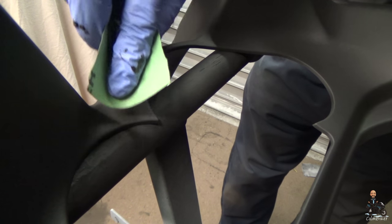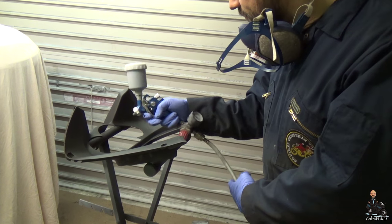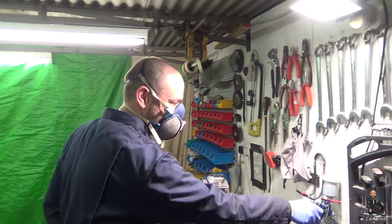Round three! Now in a dusty garage you're bound to get a few bits of dirt in your paintwork. We have. So we're going to nib them out with a bit of 1200 grit. The lightest of touches just to get rid of those bits, flatten them back down. Then we'll blast it off with air from the gun and carry on painting. The gun has two settings — that's just air, got to squeeze more for paint. That's the final coat of paint on. I'll just leave it to dry and I'll come back later.